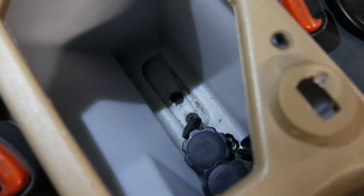I have to clear out my glove compartment and pull the bolts that are in here. Oh gosh, in this abyss. There are bolts down there. Those need to be removed so I can slide the whole center console back as far as I can, to where I can get the dash pulled as far forward as possible. And then we should be in business as far as pushing the lines off the heater core. God, those lines are a pain, by the way. Pulling the heater core back, yarding that thing, tossing the new bastard in.